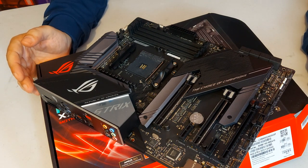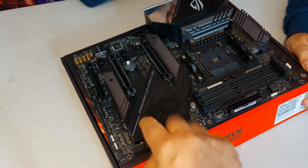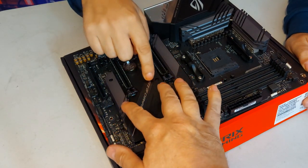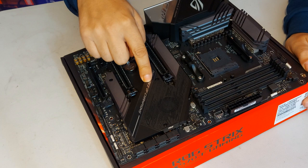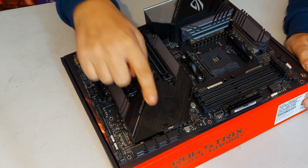Where's the M2 drive slot? Can you see them? See the socket there? So we need to take this heat sink — that is probably the heat sink for the M2s. There might be pads on the back. So heat sinks here, all the M2s — a couple of screws to take this off.